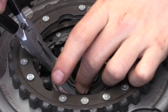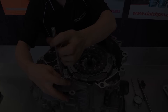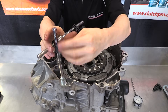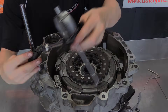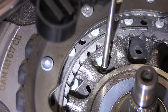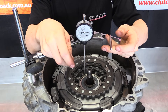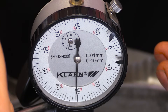Install the new clip on the support shaft on the top side of the bearing. Mount the dial indicator on the bell housing and set it up on the bottom clutch disc. Using two lifting hooks, check the float in this clutch disc — the disc must move between 0.3mm and 1mm to ensure there is not too much clearance for engagement and enough clearance for release of the disc. Check the lift in three spots on the disc to be sure of the clearance.